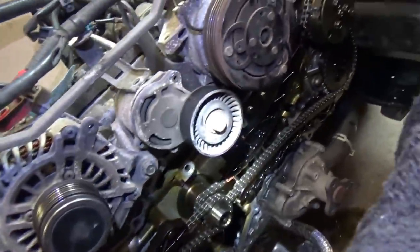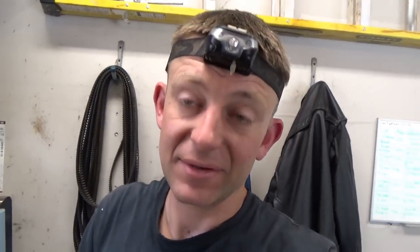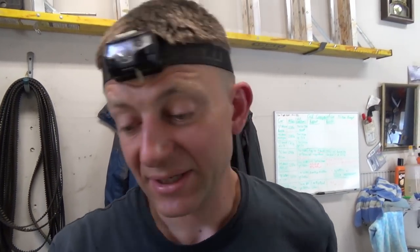We're in good shape. What I want to do now is pull the plug out of cylinder number two, turn the engine over, and with a borescope check the condition of those valves so we can inform the customer what's coming down the line, considering how bad the ones on the right-hand side looked. I'm assuming the ones on the left aren't any better. Just to give them a heads up — we fixed the right cylinder head and the engine should run perfect, but in the not too distant future there might be a similar problem with cylinders two or four. It'll be the same procedure. If it was your own car, obviously do both sides.